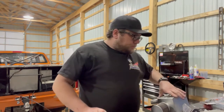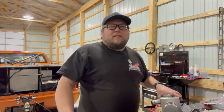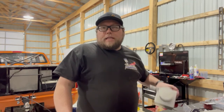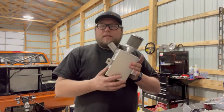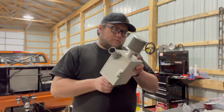This is a blower car. Blower cars unfortunately very often push the head gaskets out, beat the rings up, and boost gets into the oil pan. When boost gets into the oil pan, that oil tries to go places other than the oil pan — that's why you run one of these. This is a one quart puke tank we quickly put together. I actually got this from eBay.